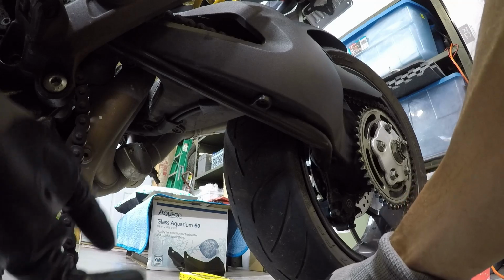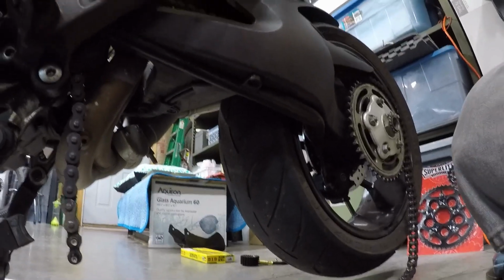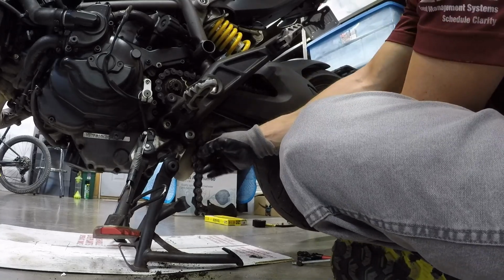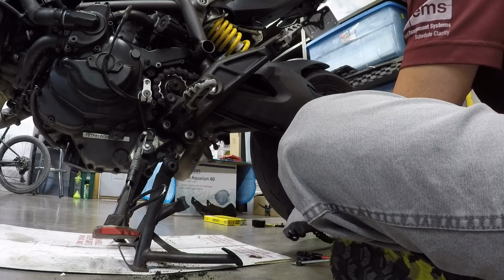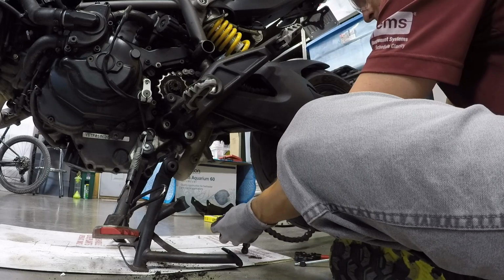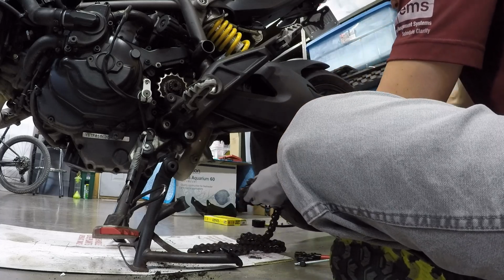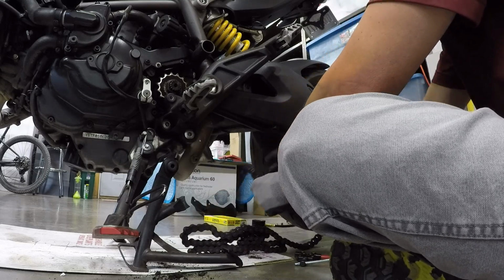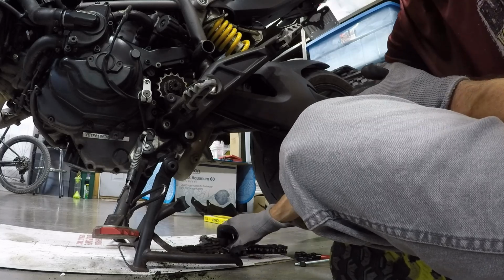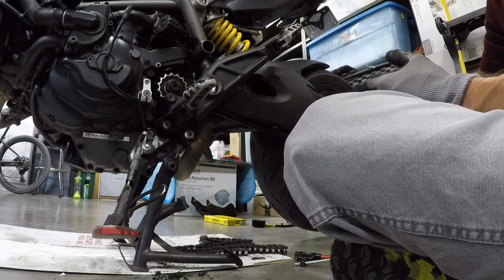So we'll pull this guy off. Might as well pull it off now. Let's see if we can back this up a little. Got it neutral. So really, you just turn the wheel. The end of the pin will come through as we roll the chain off through the back sprocket. So this is overall a poorly maintained 20,000 mile chain, which was probably stretching it, and literally it's stretched pretty far. So that's what we're doing for now.